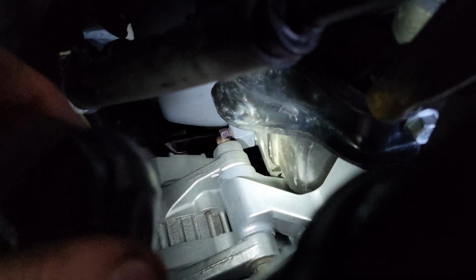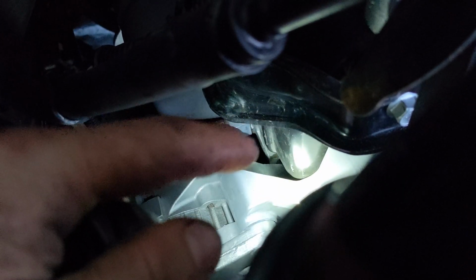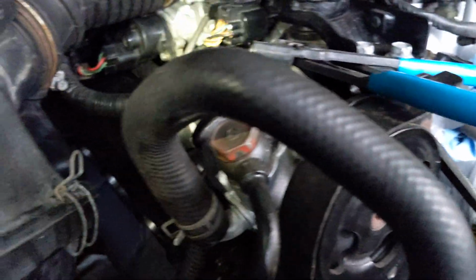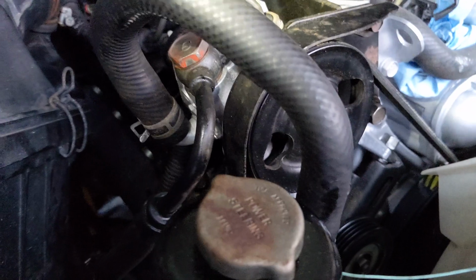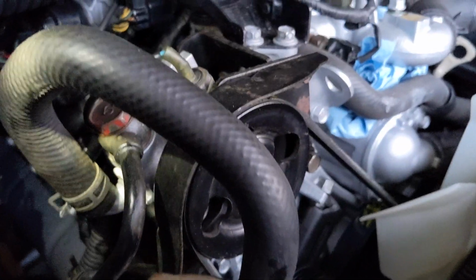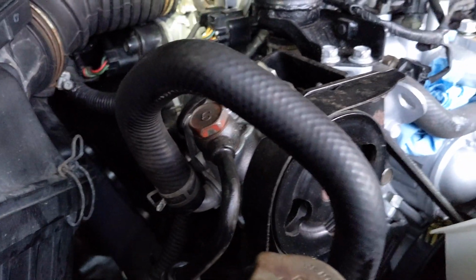Yeah, so that corner there, you see that black spot there? Well, that's not oil, but that's exactly where the oil is coming out. And one of the cams, I wasn't sure when I put the cam seal in. There is a special tool to push it in for exactly a certain amount of millimeters, and straight. I think what could have happened is that I pushed it too far back, so now it fell all the way back, and in the back there is a cavity.